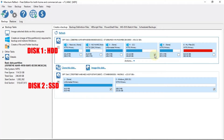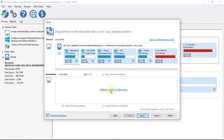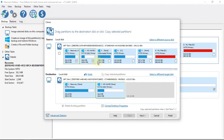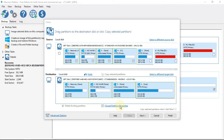On the HDD, you can see partition C and partition E. Along with that, you will also see four other partitions which don't show up in the file explorer — these include the boot partition and the recovery partition. We would need all of them except partition E to be cloned onto the SSD. Click on the 'Clone this disk' link below disk 1. In the lower pane, click on 'Select a disk to clone to' and choose disk 2 which is the SSD. Click on each of the partitions on the SSD and click on 'Delete existing partition' — this will give us a clean drive to begin with. Next, one by one, drag each of the partitions to be cloned onto disk 2. It would be easier to drag the biggest partition — partition C — in the end after all the rest have been dragged, as this will resize the free space automatically.